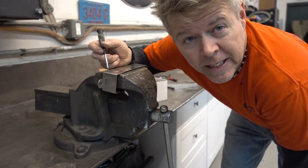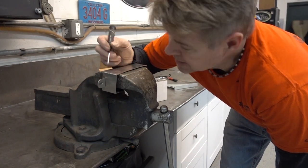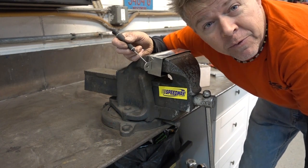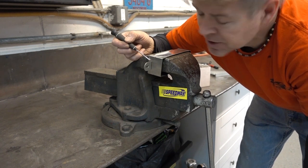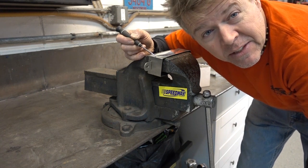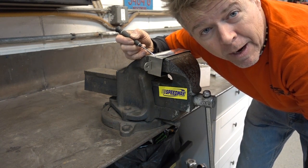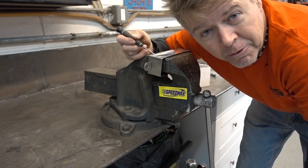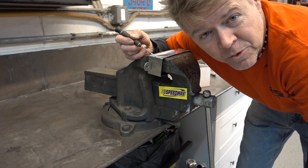It's just not what we need, so we have to make some changes. What I've already done: it's almost a two-inch deep box. I had to move the brackets back all the way to the edge, cut them off, and re-spot welded them — easy thing to do. I've marked it seven-eighths of an inch deep, we're going to cut that off to give the box the right depth we need. It should be a pretty easy process — a great little LED third brake light to add.